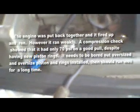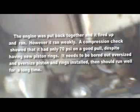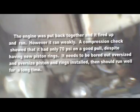So when this new one came, I did the same check again. Okay, I checked from the spark plug boot to ground, and it showed 5,000. On this one, the primary winding, I checked from here to ground, and it showed about 1 ohm. So I know the magneto was good. It's brand new and it cost $85, so it better be good.